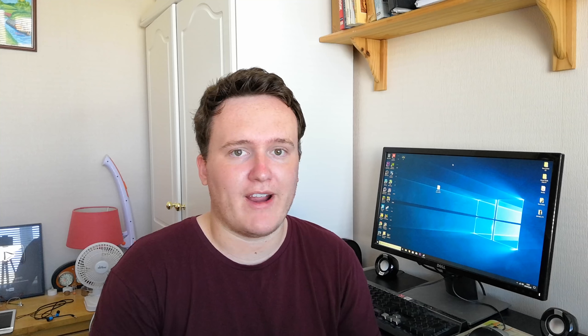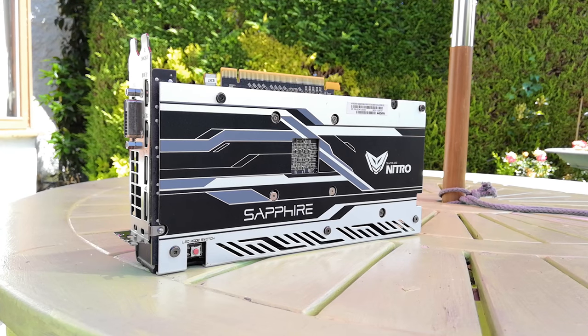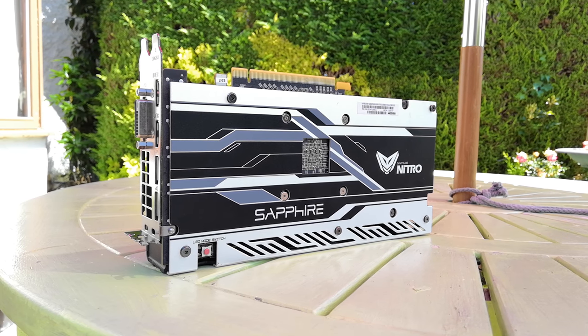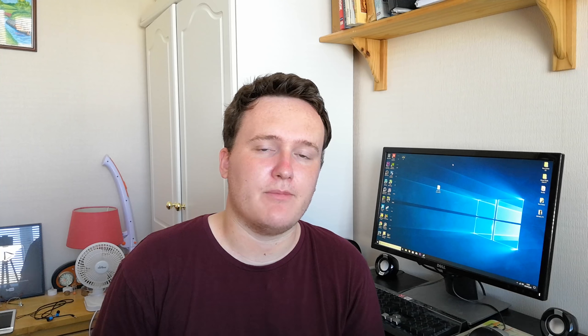I think now seems like a pretty good time to buy an RX 480. The one I'm using today is the 8GB version, but if your budget can't quite stretch to it, don't worry because the 4GB version shouldn't differ too much in performance. With the 8GB version you may see a few extra frames here and there, and it will allow you to turn those texture settings up a little bit more. So here we have the Sapphire Nitro RX 480 — I love the Sapphire versions of these cards. They look pretty standard at the front, but at the back we've got a nice aftermarket backplate. This one cost me £125 from CEX. It comes with a two-year warranty and it has 8GB of GDDR5 VRAM. The rest of the specs are on screen, and it also requires one 8-pin connector. We'll be pairing it with the i5-8400 and 16GB of 3200MHz RAM.